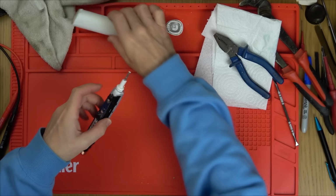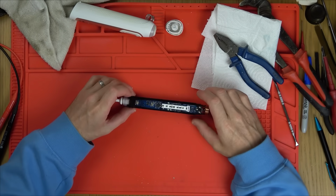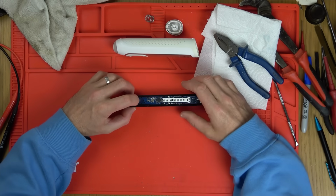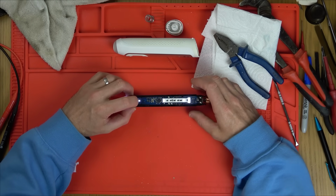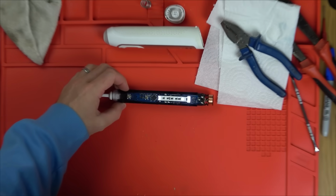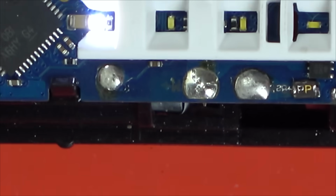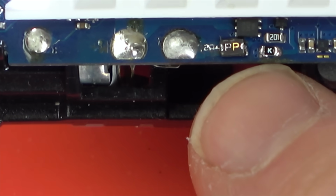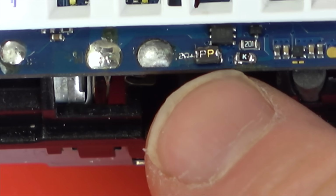Right, okay, let's see with that messing around there, is it going to turn on now? Which is on again? The top one. Excellent, it's not. Right, let's zoom in. I'm going to show you the PP fuse, and let's see if we can press down on it and get it working again. It's so bizarre, isn't it? What a bizarre fix. It's this little one here, PP, and you can see I changed the one next to it as well, but the original fault was the PP.